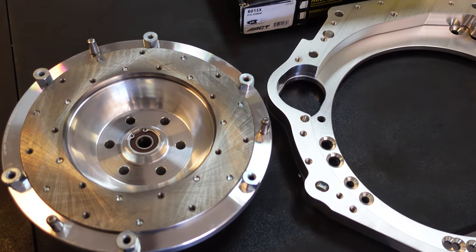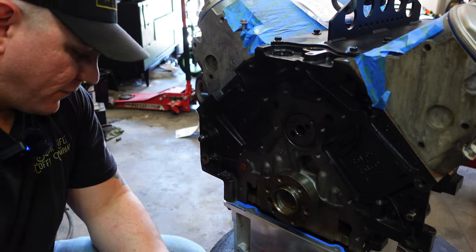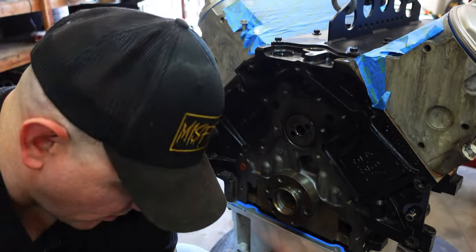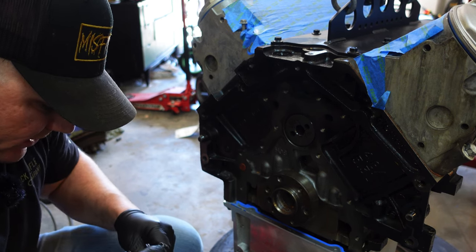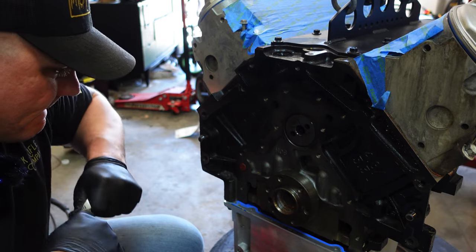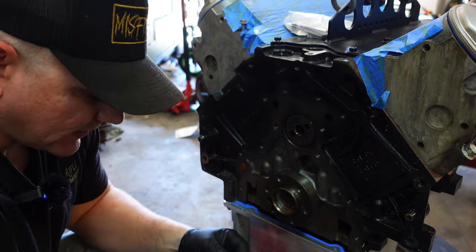The first thing I'm going to do is actually replace the existing oil galley barbell with this one from Improve Racing. We kind of talked about it before — we're going to get rid of that plastic one and put this billet, double-gasketed billet oil diverter in. See that? That's what diverts the oil. Oil galley barbell, whatever you want to call it — this is what it is.